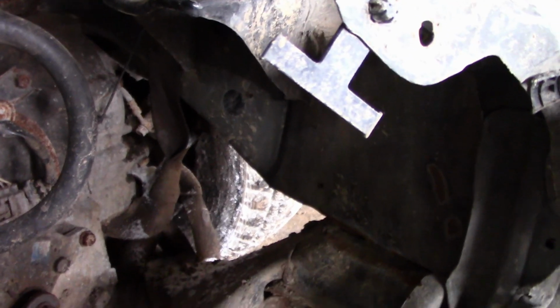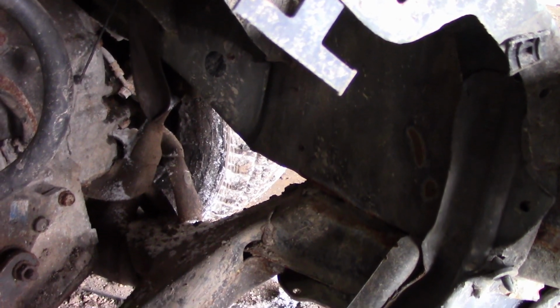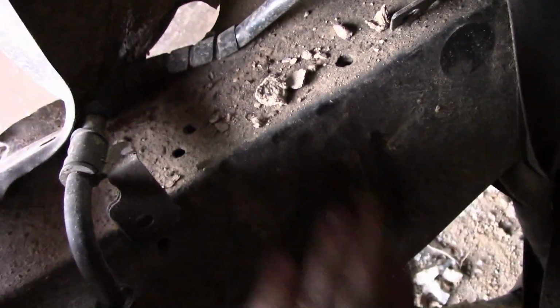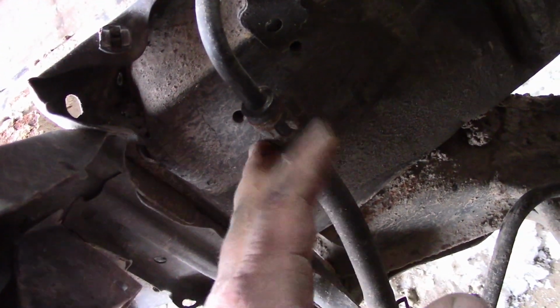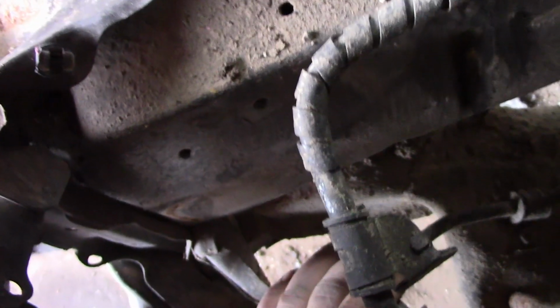The main spot where this car is bent is right underneath the battery tray. It's kinked pretty hard. So I'm going to probably cut out a little bit of the battery tray and weld in my 4" by 4" plate right there. This side here has started to go, but I don't think it's big enough that the officials will let me put a plate. But right here is actually blown apart. You can see a nice little rip right there. So maybe I'll put a plate here, because that is quite obviously bent, and see if I can make that do anything there.